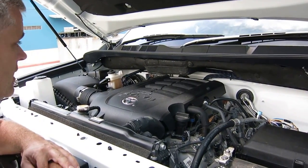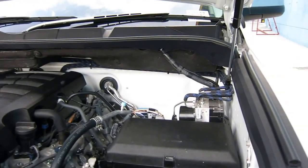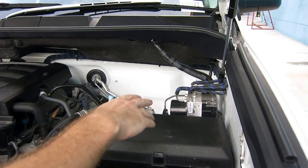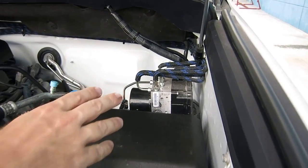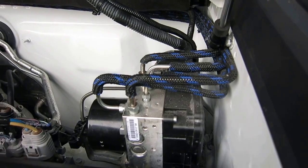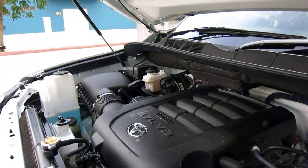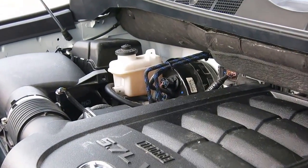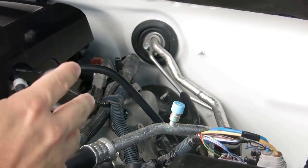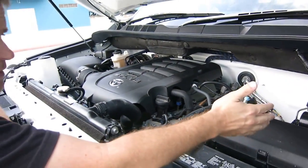All of the brake lines have been changed on this vehicle. We had to make new brake lines because of the location of the computer in the vehicle. As you can see, all of our brake lines that have been fitted have insulation braiding coating on all of them. We've put that on all of our pipes, whether it's air conditioning pipes or brake or power steering hoses. This vehicle doesn't have it done on the air conditioning pipes because they're the originals - we actually haven't had to touch or change those whatsoever. So under the bonnet, this remains a very, very simple, nice conversion.